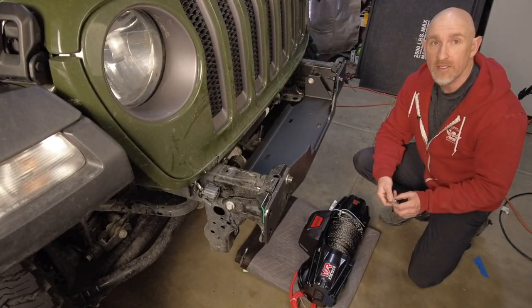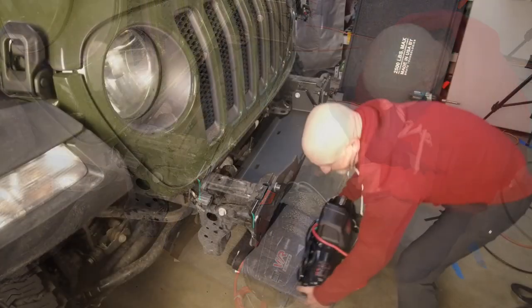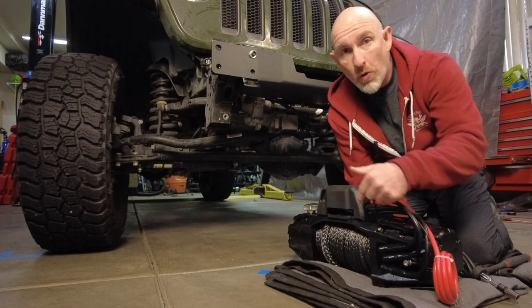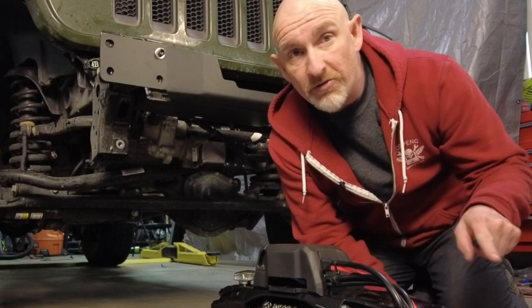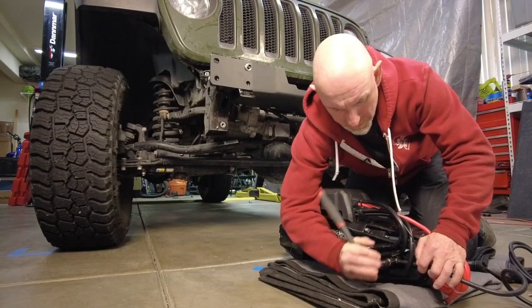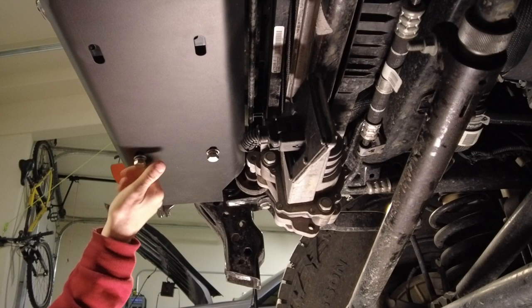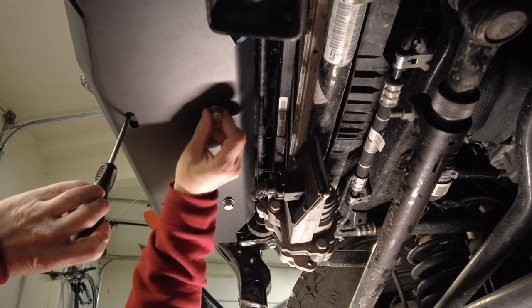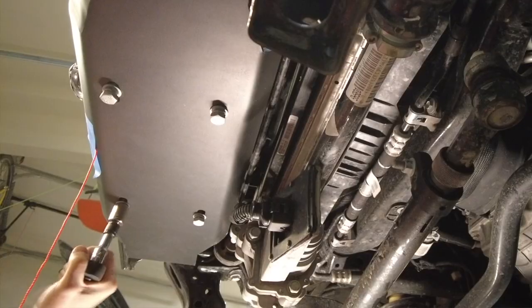Before you put the winch on the winch plate, take these square nuts and put them into the mounting slots on the winch. Then pick up the winch and put it on the center of the winch plate. We test fit the winch and the wires were coming out the back, which didn't leave enough space for the winch to sit flat. So I modified the case so they came out the side and now it will fit. Now we need to attach this earth lead to the winch and then we can install it. Lift the winch onto the winch plate and loosely secure it with the provided nuts and bolts. If the bolt holes don't line up exactly, you can use a screwdriver to line them up. I ran a string down the middle of the Jeep to the center of the winch plate and moved the winch so it's in the middle. Now I can tighten the bolts up underneath.